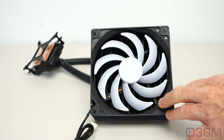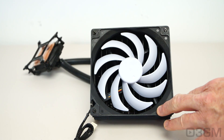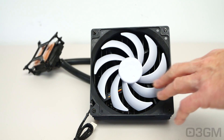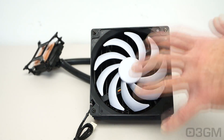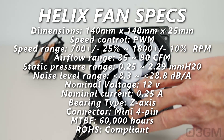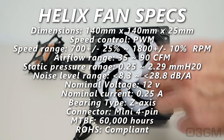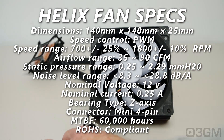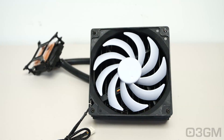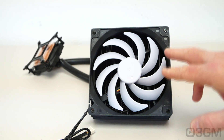The different components include a very fancy — and I do mean fancy — fan. This is a Swiftech 140mm x 140 x 25mm Helix fan. I have a few of these fans in my system. Excellent — can't say enough about them. Brilliant fans. The airflow is 35 to 90 CFMs, the noise level varies between around 8 to 29 decibels, the voltage is 12 volts, it has a 4-pin connector, and a sleeved lead. The fan is pre-installed and designed to pull in cool air from outside the case.